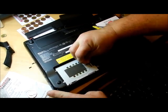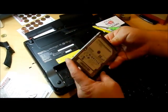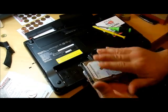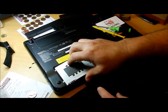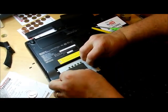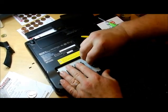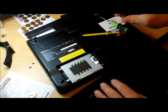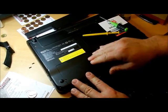You need to pull this straight back and this part up. These tabs go back inside the computer and allow you to take it out. It's a 500 gigabyte hard drive with four screws - remove those, and put it back in the same way with the label up. Take the tabs and stick them all the way in, drop it down inside, and pull until it seats. It takes a little effort - it has to line up. Then put your screws back in, put the cover back on, and click it down into place, tightening your screws.